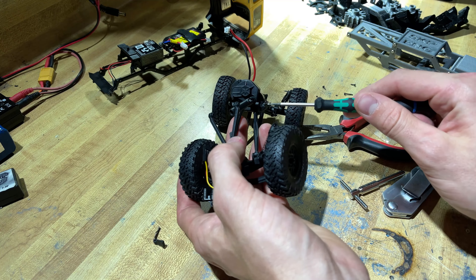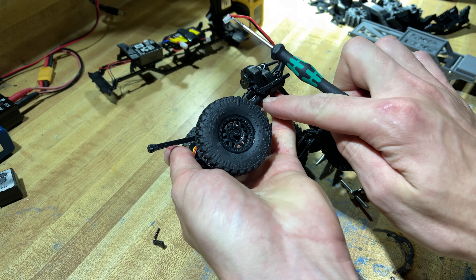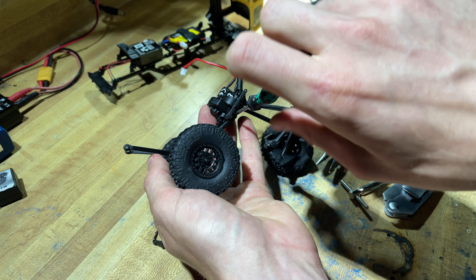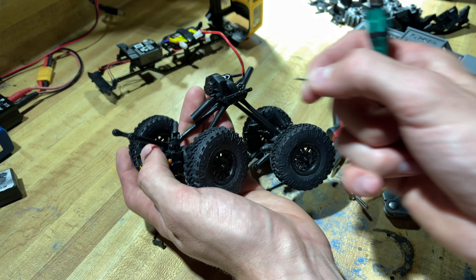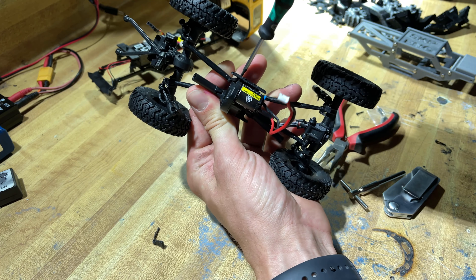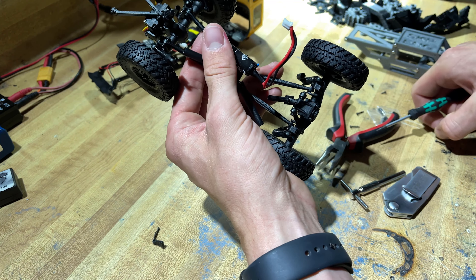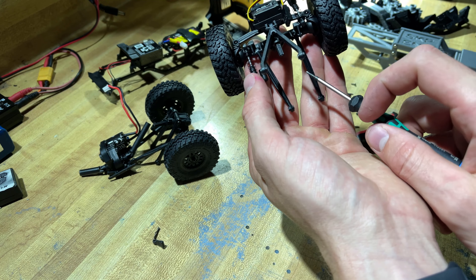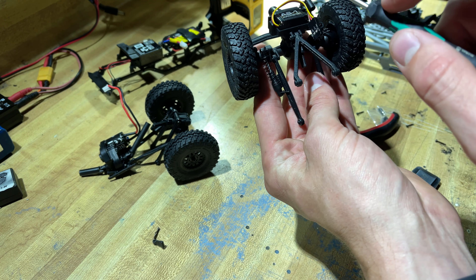To start, we are going to take the bottom links off — this is the front of the vehicle, the front has the servo. We're going to take these two screws out of the bottom of the front of the transmission or skid plate assembly. These are also long bolts, same length as the two outer ones we just uninstalled. The whole front end of the truck will now separate. What we're basically doing is taking these two previous bottom suspension arms and moving those to the top, and also forelinking this. So let's remove the stock Y-link up front — we'll be getting rid of that.